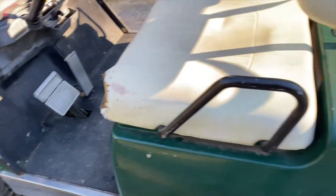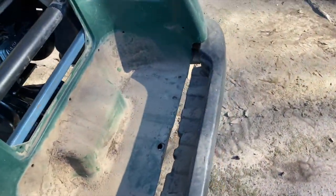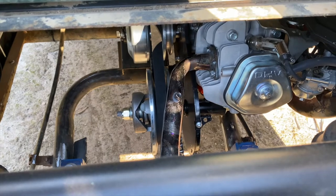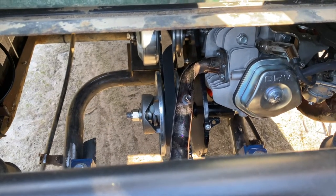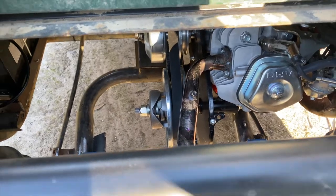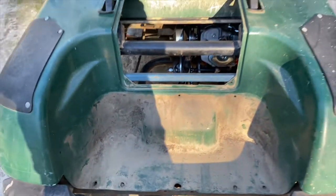We're going to jump onto this golf cart, put the body back on, and go for a good rip. But we got stuck — battery went flat. I turned it off and noticed the jackshaft came loose down the middle there, the new one we fitted just before. I think it might be the anti-seize on the nuts, so I'm going to double-nut them. I'm going to have to walk back and get a spanner and tighten those up.